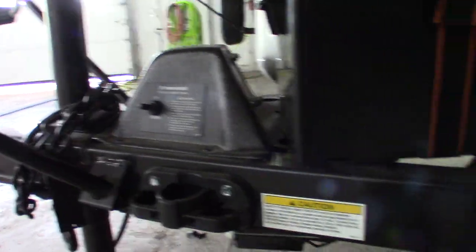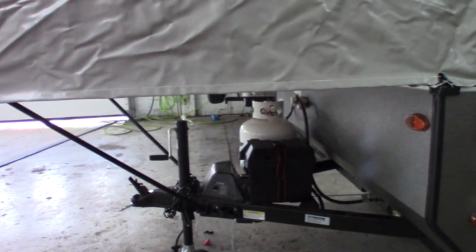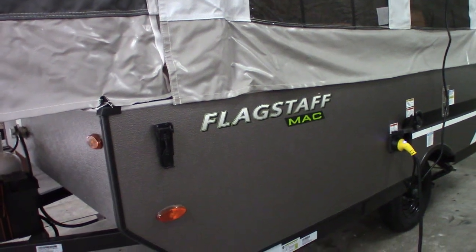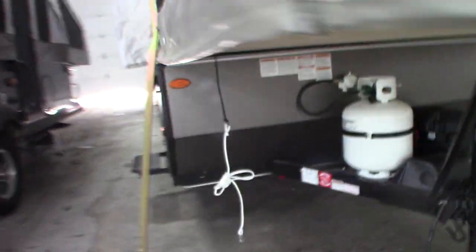So, okay. Up and down, always make sure that all four of these are unlatched. Whoever's in charge of the winch is also in charge of the latches. So even if someone tells you that they're unlatched, you still have to look yourself to make sure, okay? It's a very powerful motor.